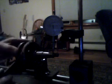Now let's check the other way, because again it's quadrant. So you're always doing 180. So I'm doing towards me, away from me. Now I'm going to do top. Reads +1. And below me reads +2. So that's actually only out. Again, because I'm using, that's actually, let's see, the bottom is higher. And the top, when the pin's at the top, it's lower. So if it's lower right now, that means it has to be sitting that way, which means that, again, the webs are too close together. So I'm going to have to spread them again and then continue working.